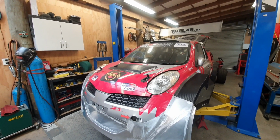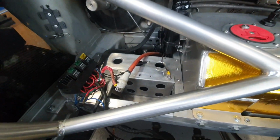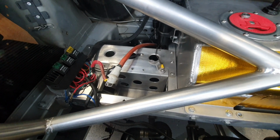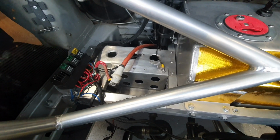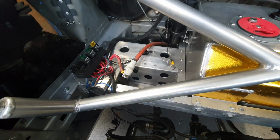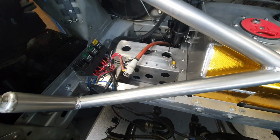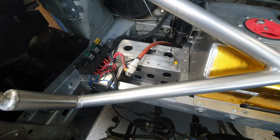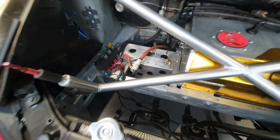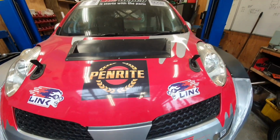Could be something to do with an earth strap that I've done, and I'll just show you that now, actually. There was a great big massive cable right there where that little earth tab is, where that yellow terminal is attached to a much smaller earth that runs off to something else. I took the great big cable out that was basically the size of that orange positive cable there and replaced it with that little aluminium tab, knowing full well that aluminium tab has got higher resistance than copper or whatever the cable was. Might have been some other stainless steel or whatever it was out in the aircraft. Not overly concerned over that, but may have been contributing. But if that was enough to tip it over the edge, it was struggling to do it anyway. So basically, a poor little thing couldn't start.